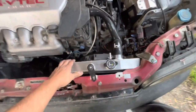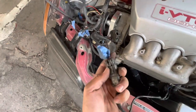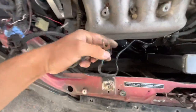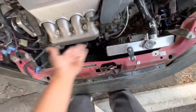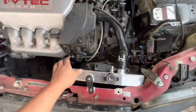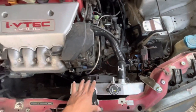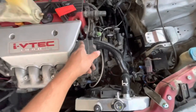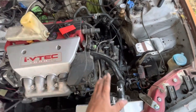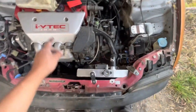Everything is officially installed. Here's our little harness — it's already plugged up to the harness for the radiator. This little relay we just have to find a spot to mount somewhere in here, get it hidden and tucked, route it under here, and that's basically our radiator fan situation. It should be okay for testing purposes and will give me a taste of whether it even starts. When it starts will depend on the coolant temp sensor, which will be a whole other ordeal I'll deal with during the wiring video — so stay tuned for that.